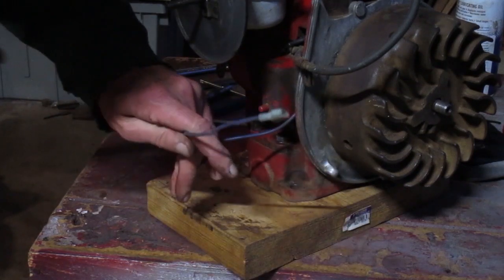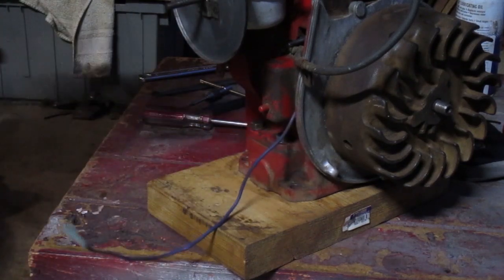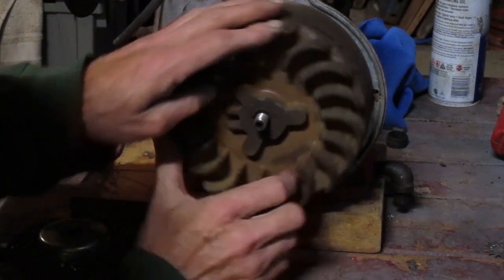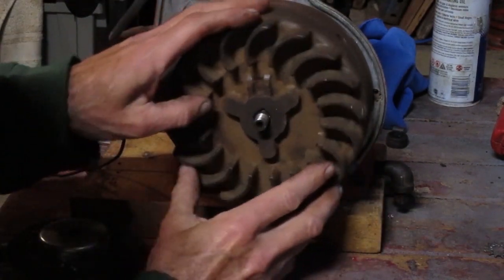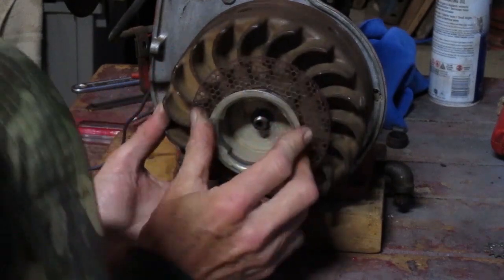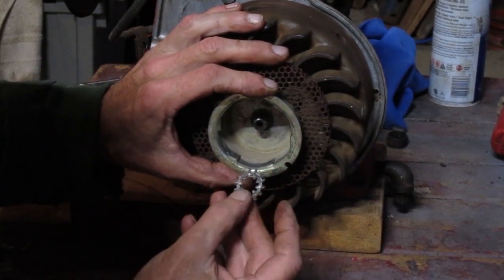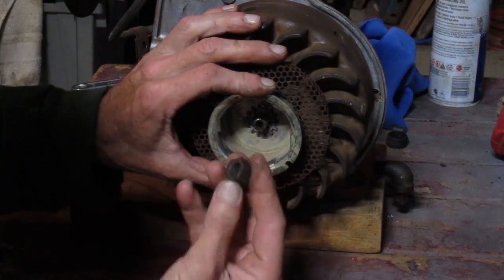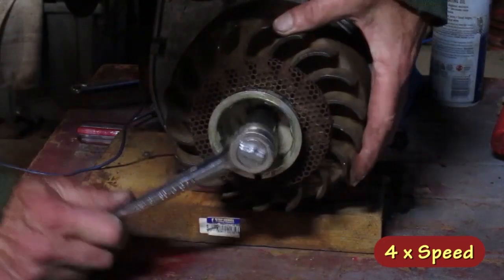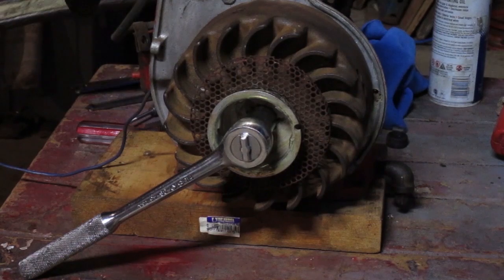This wire goes to the kill switch on the tractor — I didn't test that yet. This is not the original starter cup. Normally there's a tang on the back to engage with this feature cast into the flywheel. I'll probably change the recoil starter later so I'll put this one on like it was — it'll work okay just because the direction of starter rotation will try to tighten the nut, not loosen it. They had this lock washer on there — it's not original but that's okay.